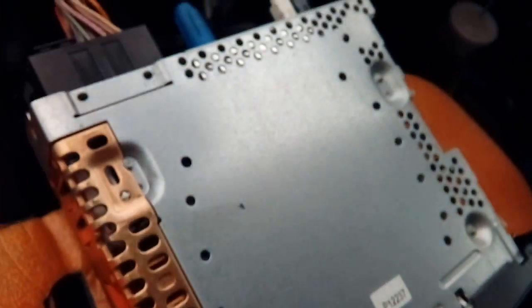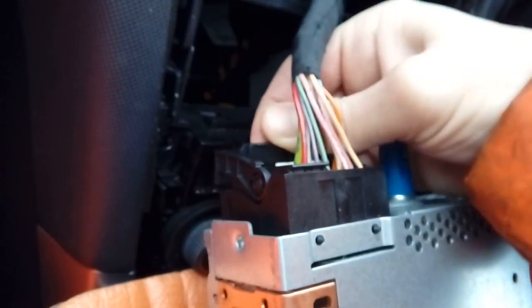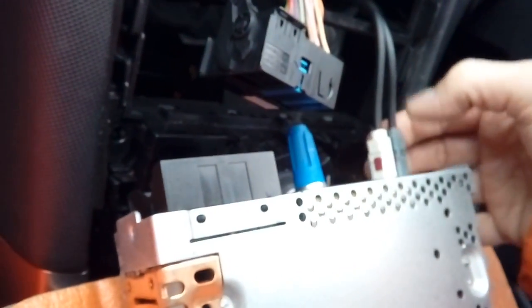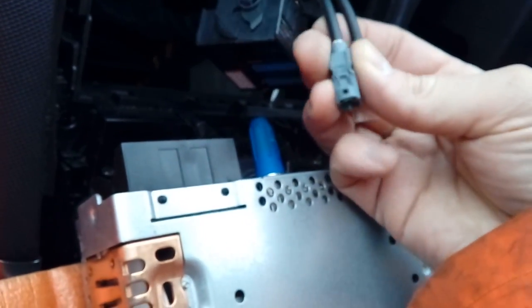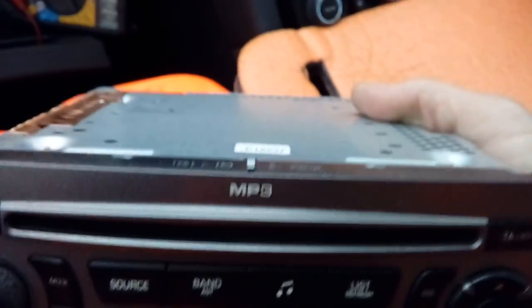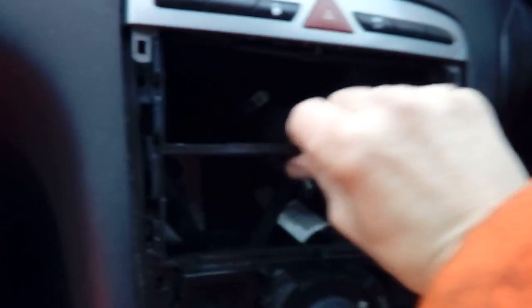I've put a little bag over the gear lever there just to make sure we don't scratch it. You can then move on to your connectors — they're pretty straightforward, like a lever system. Pinch the bottom, rotate, and out it pops. The aerials have a pinch again at the bottom — pinch and pull. Take your radio away. If you've forgotten and left a CD in, plug it back in now and get it ejected. A lot of people leave CDs in radios and then need them fishing out afterwards.